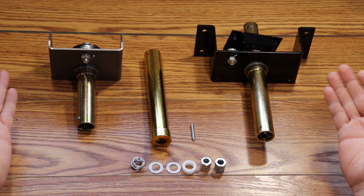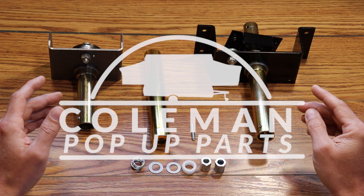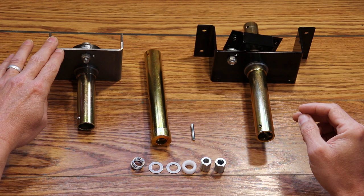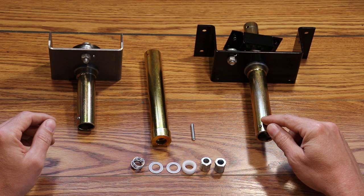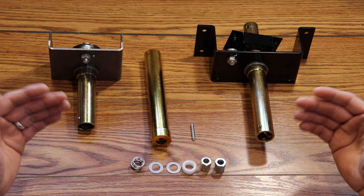Let's talk about installing a new drive hub extension on your pop-up camper. There are four sizes of drive hub extension tubes, and we have all four available at our web store at ColemanPopUpParts.com. The two smaller sizes are most commonly found on upper chain-driven crank assemblies, always found behind a body panel — with the exception of some Grand Tour and Highlander units that have a larger drive hub tube that comes through the spare tire. The two larger sizes are most commonly found on direct drive systems located in the center of the bumper or to the left. You can find the kit your pop-up calls for at ColemanPopUpParts.com by looking in your parts book or by measuring the length.